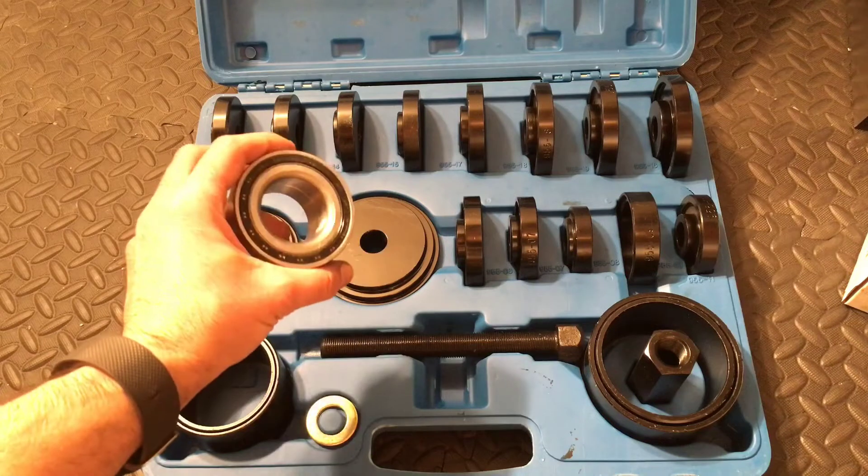And I think we got it. There we go — the bearing race has been pushed completely out. Let's go ahead and take this off so we can take a look at it. So this is the bearing race that was lodged in there. What had happened is when we pulled the hub assembly out, the inner part of the race came out with it and kind of messed up the whole bearing, making it hard to get out. We were still able to press it out by hitting along the lip in here — this bit fit right inside there and was able to push it out. Normally you want one that's big enough to go around the outer edge, but in this case we had to work with what we had.